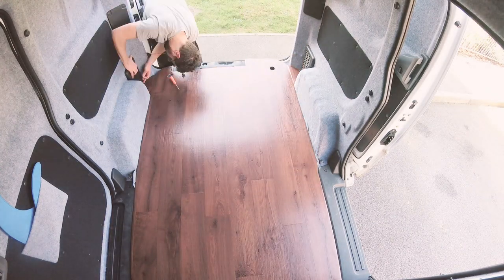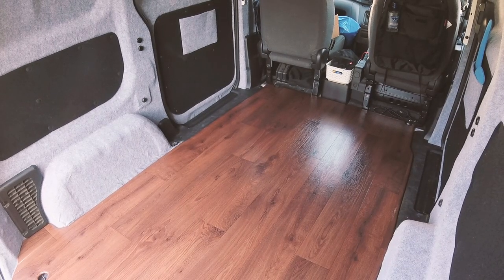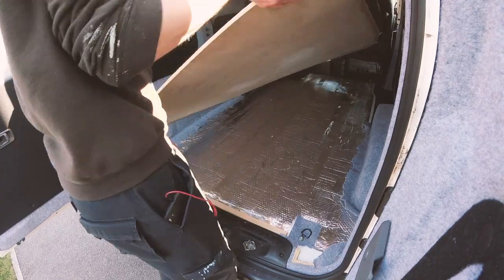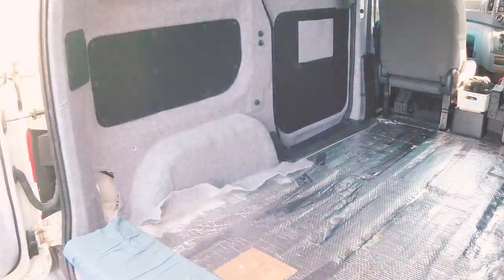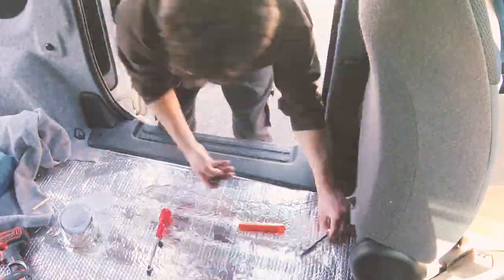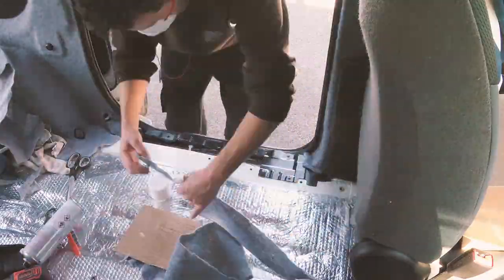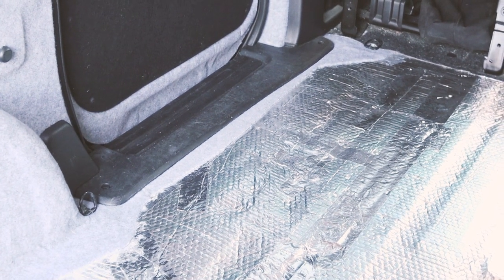I could then return the floor to the van to see what the fit was like. Overall, the floor fits really well. As expected, I had to remove one of the two rear vents to get the side pieces to fit, but once replaced it's a great fit. I could finally see how this flooring looks in the van, and I have to say I'm really impressed. The dark wood vinyl has a warmth which looks really good. At this point I still had a few adjustments to make, as well as sorting out the rubber trim that would cover the edge along the back. So I removed the floor again and started by gluing down the flaps of carpet by the wheel arches. I had left these after carpeting the van as I knew I would have better access to stick them down with the floor removed. I then cut away any excess and made sure the carpet was sitting flat. At the two side doors, I laid a strip of carpet running from the top load ring down to the wheel arch, to cover any white metal floor still visible in gaps between the black door trim and the floor. I had some leftover carpet that I was able to use here. As you can see, it gives a really nice clean look to both side door trims.